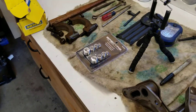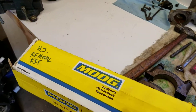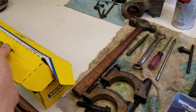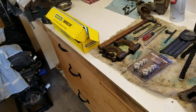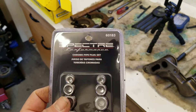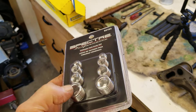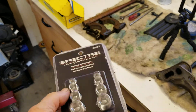We got our kit set up — we're working on our balance shaft removal kit. There's a reason why balance shafts' initials is BS — that's the BS removal kit. In there is everything we need: all the drill bits, the taps, and everything. This is a block plug kit picked up at AutoZone, and we're not going to use the half-inch ones — just the three-eighths and these little eighth-inch ones.